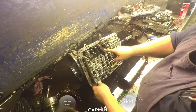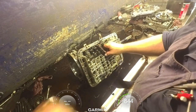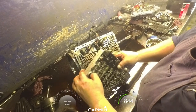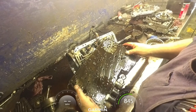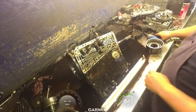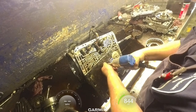On early models this would crack and let that solenoid come out, but they can also wear out. You want to make sure that the solenoid is nice and tight and not just flopping around in there. The 95 and 96 models use a green solenoid. From 97 up it uses a red solenoid. You don't want to screw that up or you will keep eating forward clutches and never get rid of the jacking thing.